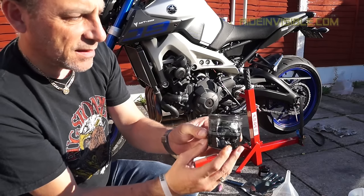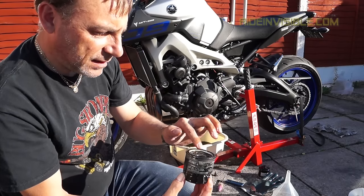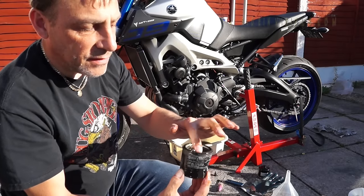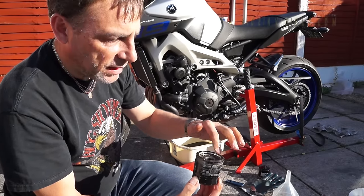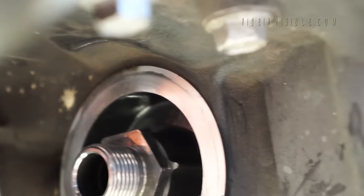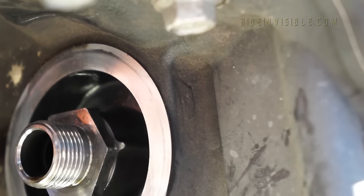You can see where I was trying to get it undone — it just cut into it. And that O-ring, although it's been lubed now by the fact of me taking off the filter, it feels rough. The reason why it feels rough is it wasn't lubed when it was first put on, and that's why it wouldn't come off — and it was also over-tightened. Hopefully you can see the black ring — that shows you that the bike got hot with a dry ring touching it, and it was also way, way too tight.